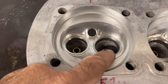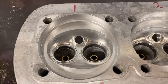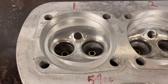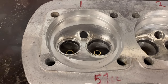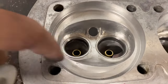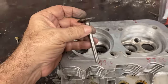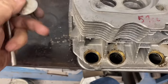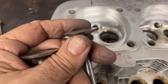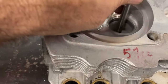I'll show you what I'm going to do to clean up these chambers. I had them roughed in before I checked the cc's — I didn't want to finish polishing them until I knew I was going to end up at the right cc's. Depending on how deeply you set the valve seats, that's also going to affect your combustion chamber volume. Because these seats have already been cut and lapped in, I've got some old valves that I cut down the head to make a razor edge on the angle. You drop them in and they set flush with the seat, so now I can go in there and polish without worrying about messing up the seat.